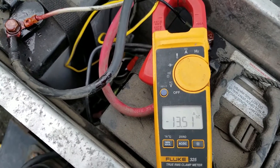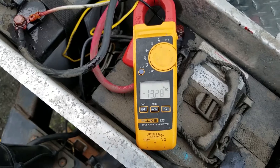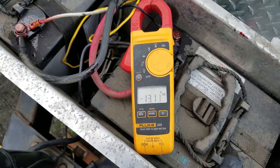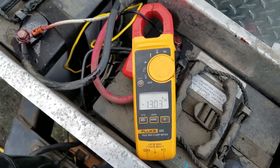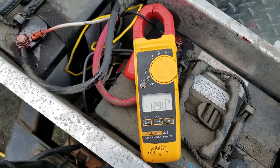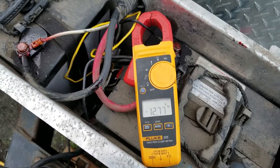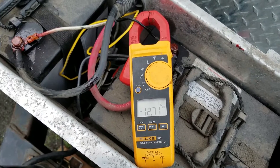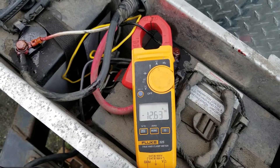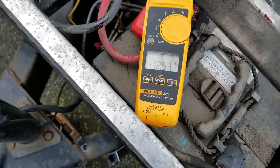Each brake is getting the appropriate 3 amps — great. If one of my brakes wasn't working I'd probably get 9 amps. If you have a trailer with only two brakes you'd get 6 amps — each brake is supposed to consume about 3 amps. We do know those brakes get really hot; on my bearing repack video we were reading 130 degrees on that brake cycling two seconds on, two seconds off. These things are getting hot right now, but still — 12 amps. Let me plug this back in.